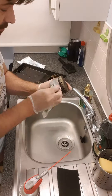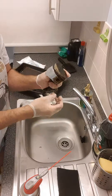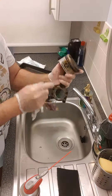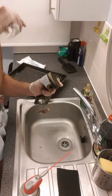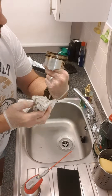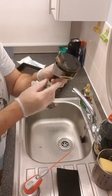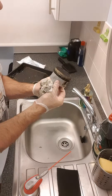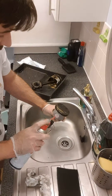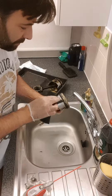So I have to get a bit of tissue, a soft bit of tissue — give them a rub down. This is the worst piston out of all of them by the way, this is piston number two. All of them are marked; piston two particularly bad. Which would be down on the intake side — all of them seem to be marked on the intake side. On the outlet side, pretty fine, they're not too bad at all. They're marked obviously — it's had 97,000 miles on the clock. The engine builder did say that the servicing must have been absolutely terrible on this; it's put the marks down on the pistons. Where obviously the pistons just picked up a bit of debris.